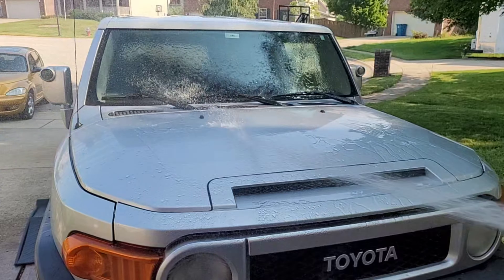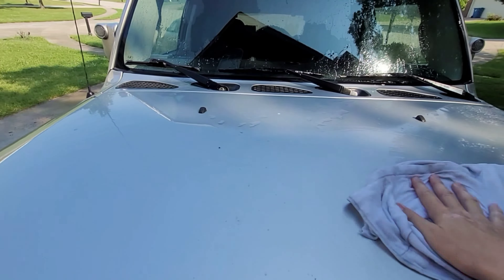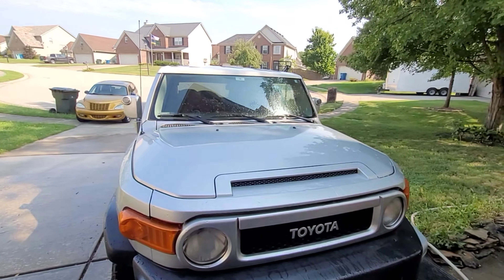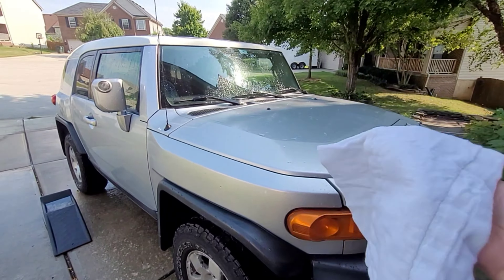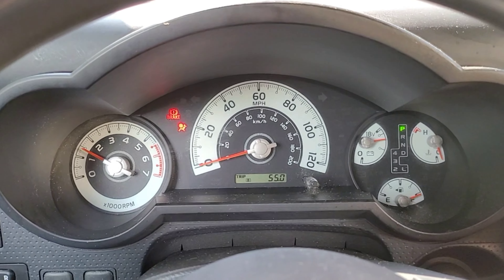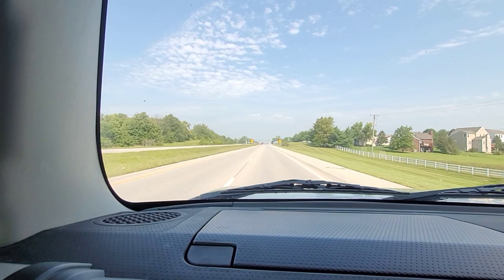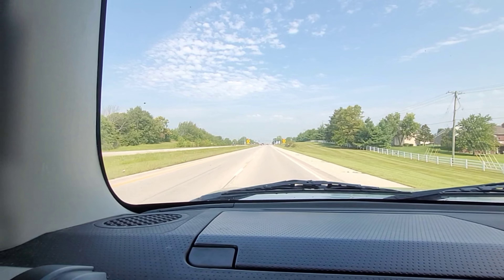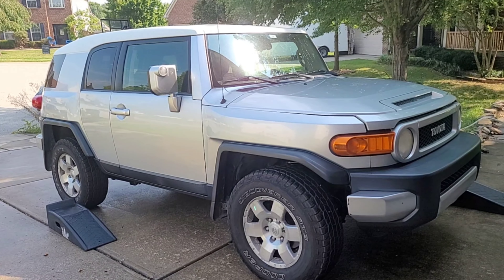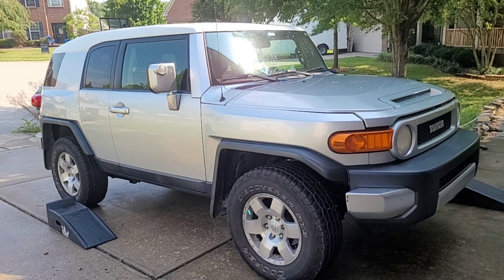Here's the car wash I'm going to be using. Rinse your car off thoroughly to get any crud off, then wash the entire car — I like starting at the top surfaces and working my way down. After thoroughly soaping up your car, rinse it off, grab a dry rag and squeegee all the water off. Then go for a quick drive to dry it off and make sure any water in the undercarriage has been shaken out. I like to take it up to about 50 or 60 miles an hour so the air blows all the water off. Let it sit overnight so any water that might have seeped in can dry out before working on the paint chips and undercoating.